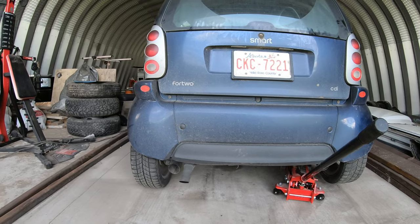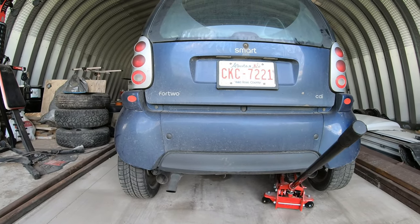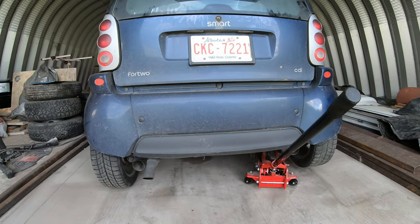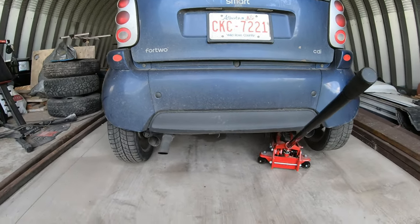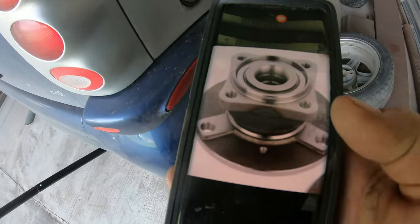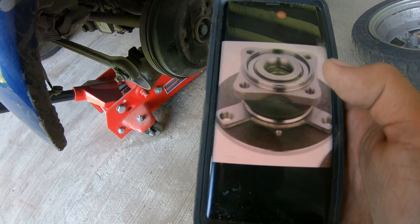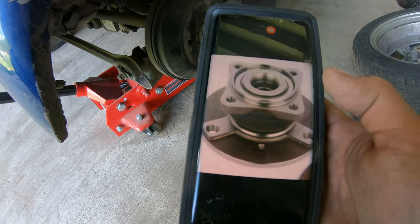Just remember: if your driving habits change — say you adjust the camber to fix the wear pattern, and then you get a girlfriend and now there are two people in the car — it's going to wear on the other side now. The wear isn't too bad, so I suggest just leaving it as-is because life changes and you don't want to keep going in there removing and adding washers. Tires aren't that expensive. Unless it's really bad, I'd just leave it. Here's a picture of the rear bearing and hub assembly — you'd be putting a spacer between two of those bolt holes. As long as you adjust just a little bit with a super skinny washer, it probably won't cause problems — but don't do it; who am I?